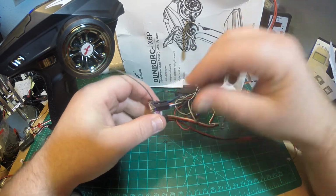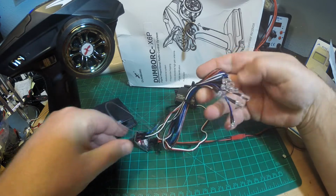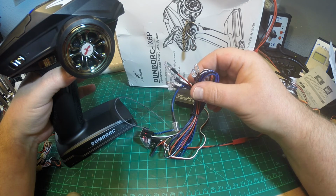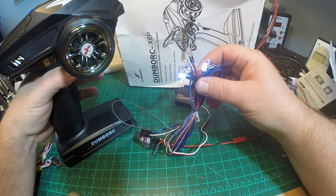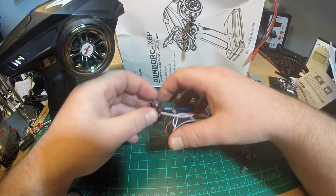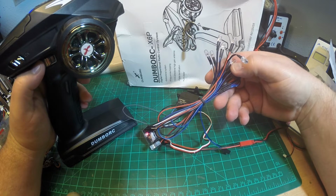And what's the sense of this? Normally you would say, if you want the car only turning on its headlights when it's running and then go off if it stops, you could use this mode, but I don't like this mode at all. There are quite a lot of ready to run cars coming with this mode, so if the car stops, stands still, no light, and if you push throttle, there is light. And you can switch it back, and now we are in whatever normal mode,